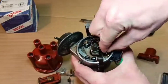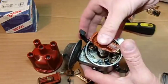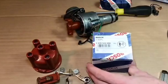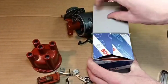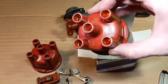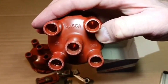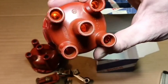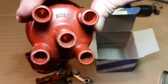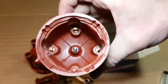There is no risk of making a serious mistake. The turning plate glides easily. The distributor rotor and distributor cap carry the original number for the latest distributor for the Volvo B20 — only for the latest type of distributor. This cap can only be fitted to the aluminum body type distributor; you cannot fit this cap to the earlier type with a steel body.